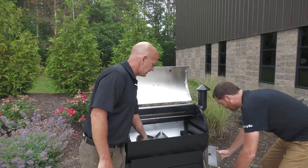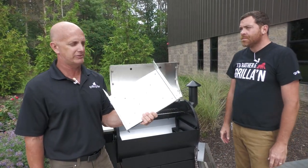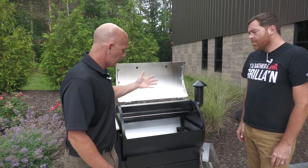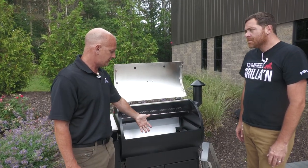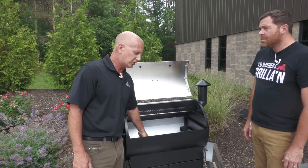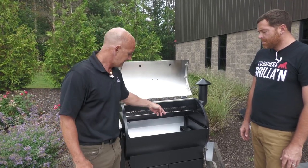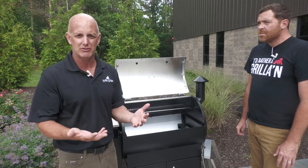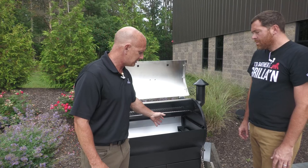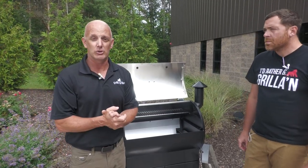Inside here you've got your heat shield. This thing you pretty much don't need to do anything with — it just gets the heck beat out of it with a 1,400 degree flame every day. Generally nothing you need to do there. The Silverback has double wall stainless, stainless steel burn pot, stainless steel interior. Keep that burn pot clean every four or five cooks, make sure that igniter is exposed, and the grill will start reliably. Keep your drip pan clean, burn pot clean, good fuel source — this thing will last.